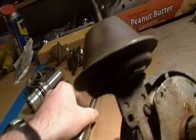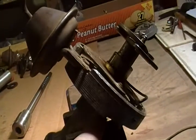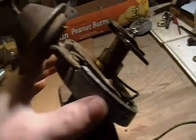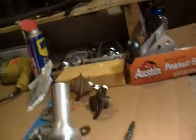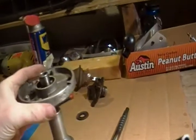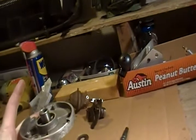So that being said, I just ground that down and polished it — same deal with this here. Once you get that apart, you'll basically hack the top part of this distributor shaft casing off, and that's what I've done here. I just used a regular hacksaw and hacked it down so it's just more manageable. There's no reason to have all of that up there with a drill chucked into it.